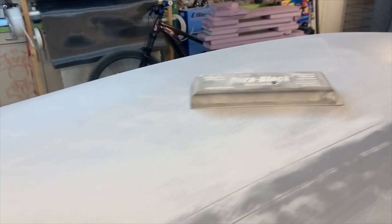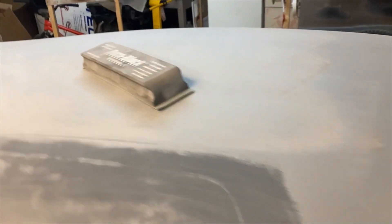The primer's cured up and I've got some guide coat sprayed on here. I've just started to dry block it with 150 — basically trying to knock down the orange peel, not really cutting it completely straight at this point. I'll do 150 and then 220 dry as well, then start hitting it wet after that, taking the whole surface down to at least 1500 before I polish it — maybe even 2000. We'll just see how it goes.